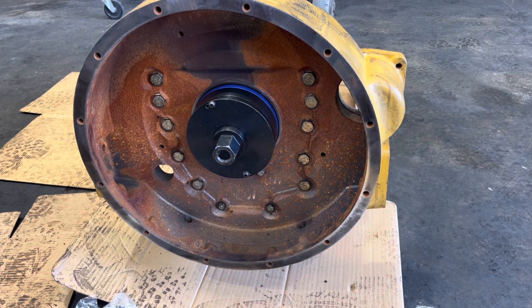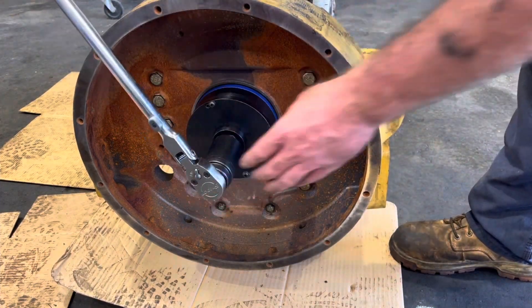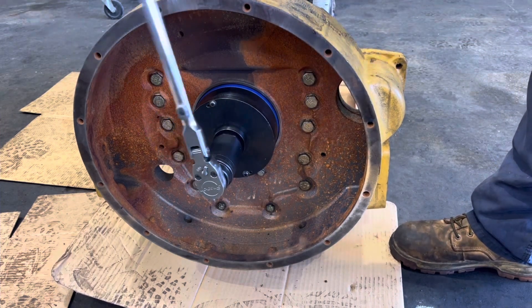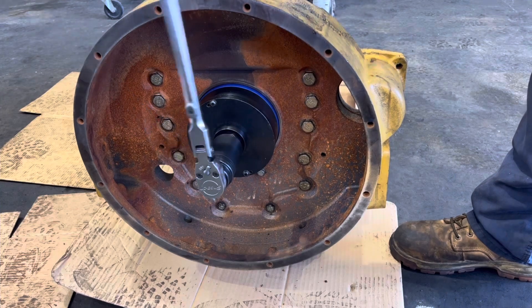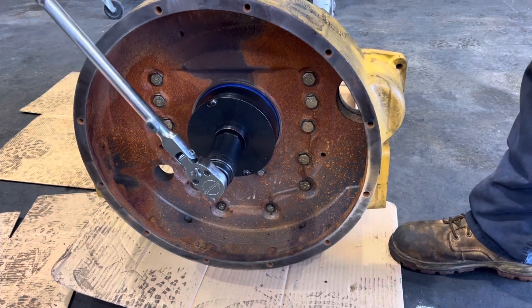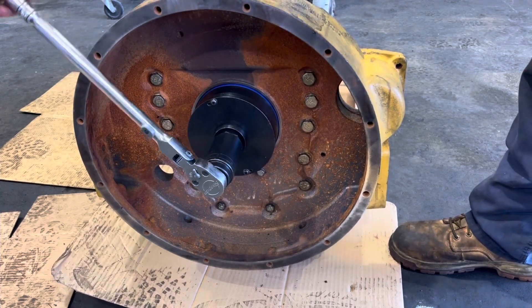Put the hub on and the nut. Now, I'm building this engine in the floor — I actually have the crankshaft held steady with a pry bar up front, which you can't see, to keep it from rotating in the block assembly. You just want to drive it home with a half-inch ratchet and socket. I wouldn't recommend using the impact on your tooling.